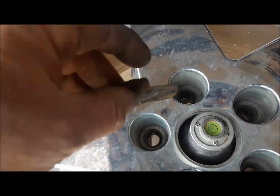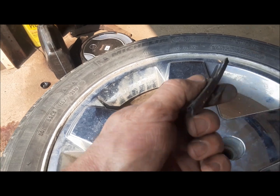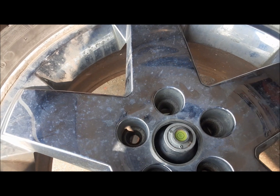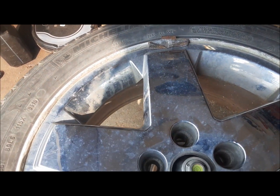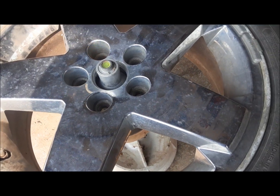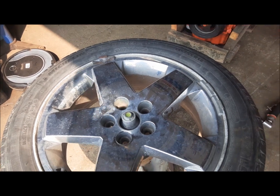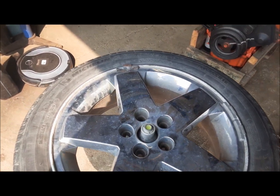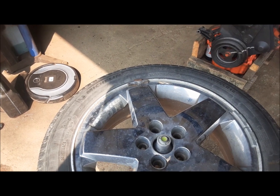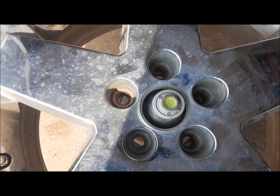It's hard to see, but this one is off a little bit. Unfortunately, all the old wheel weights I had I melted down to make ballast for the race car. I got that little guy on there and that seems to sort it out a little bit. I hate balancing a balance job, but I'll hammer that on there and try it on the road and see what happens. It says she's good.